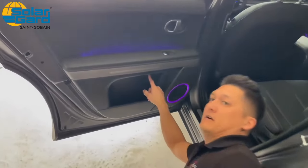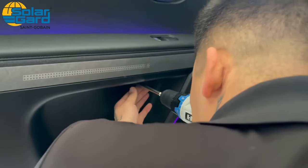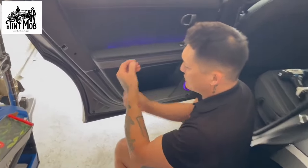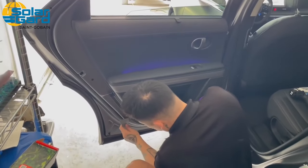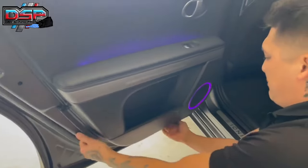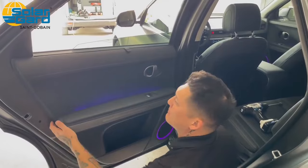Over here, right down underneath the door panel, is the second screw — and it's only two screws total. Usually they take the same torque setting on both. These screws look pretty similar, but one is a hair longer than the other, so remember which one came out of which hole. From here, it's pretty simple: take a Platinum Easy Reach, get up underneath this frame, and pull straight back from the bottom, then keep pulling up. We're not connected behind the door handle at all — it does sound bad, but it's fine.